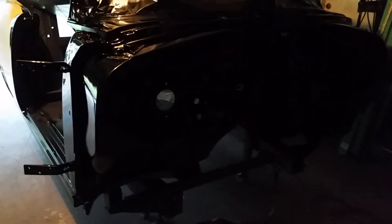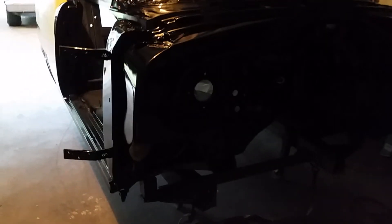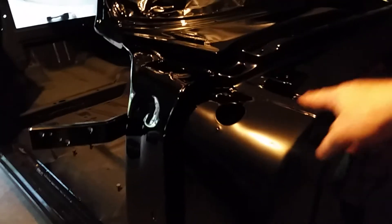I put the fast activator in it. I got four coats on it, not one run, not one sag. There are a couple little small areas that have a little bit of dry spray, but it's really, really light. What I really wanted to flow out was the toe boards and all down there below the curve — all of that is slick. Even my jam areas are slick, but I just got a little bit up on these edges here.